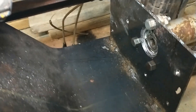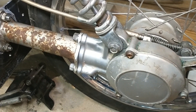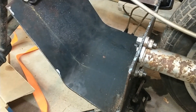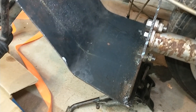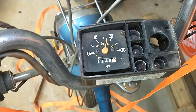In case anybody's ever working with one of these, the gear ratio on this rear end is 5.5 to 1, and it's an 18.5 inch wheel. This basically means for every 100 RPM the motor turns, it goes one mile per hour. So a 3,000 RPM motor - which is what that Ryobi motor is - will be about 30 miles per hour, which is all it ever did as you can see from the old speedometer.